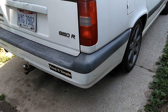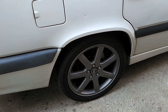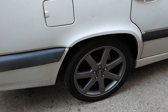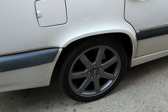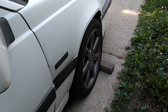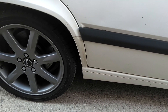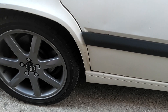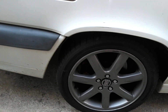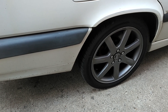Hopefully we'll get a decent video on doing that. A lot of times you don't even know these end-link bushings are busted. Sometimes you can hear some banging around, but the big thing is it knocks your rear out of alignment and you start eating up tires. First thing we do is put the car in park, chalk the front wheels so the car doesn't roll forward, jack up the back and put jack stands under it — probably right on the delta link points. We'll take the wheels off to lighten the load and get some lighting under there.